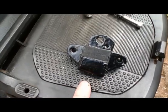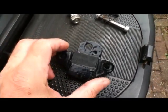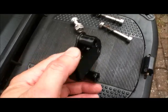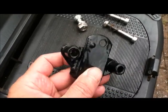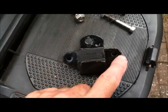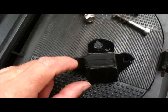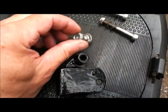This is the suspension bracket, and it's got a rubber block inside it. It was really quite rusty so I've stripped it, cleaned it, and painted it very thickly with Hammerite Smooth — probably more thickly than I needed to, but that'll last about five years of normal use. The trouble is you can't strip it with a heat gun because of the rubber block. I'm also going to treat it to a lovely new shiny bolt.